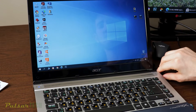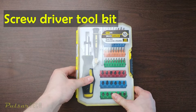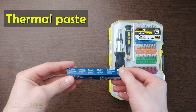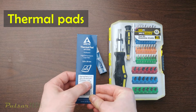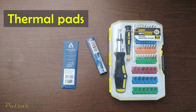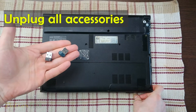Before disassembling the laptop, make sure you unplug it, shut down the operating system, and get started. For this job, we're going to need a general toolkit with a screwdriver. We're also going to need the thermal paste - I just bought this Arctic MX4 thermal paste. And we're also going to need thermal pads; these are the one millimeter thick. There are also options of half a millimeter and one and a half millimeters, so make sure when you disassemble it, you measure and see which ones you have and install the same ones. Let's first unplug the mouse and Bluetooth USB adapters.